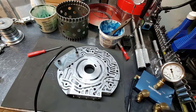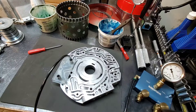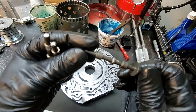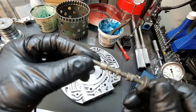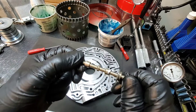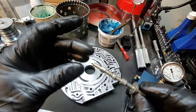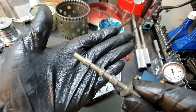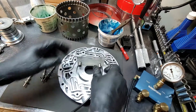I have a 6L80 pump and I'm getting ready to install a shift kit on this pump. I have three valves here — the original valve which is in real good shape. I have another one that's worn out all the way around, and the back side is also worn. Then I have this one where the spool on the valve is completely shiny, which means it's almost completely gone.